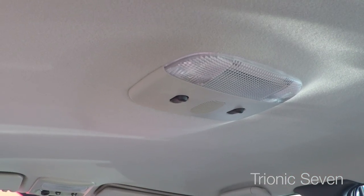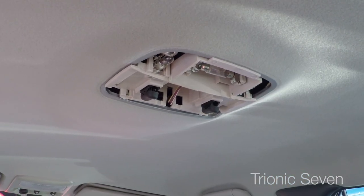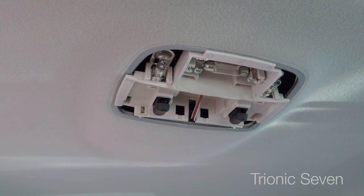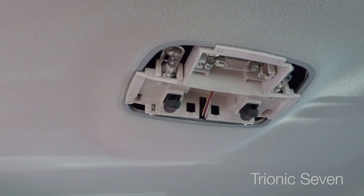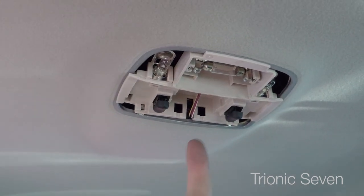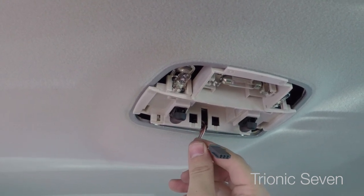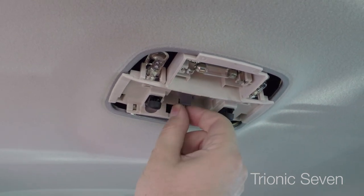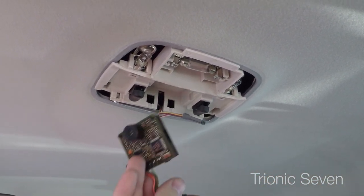So far this retrofit guide is going smoothly - we're just cruising through it. Now we remove the light cluster in the rear seat area. As I was doing the research for this video I was looking for all the wiring harnesses and connectors for the sensors and just couldn't find it in the rear. I even removed the whole cluster and felt around in the roof. Had I been looking from below or from the front I would have seen it right away - it's this little cable. This is where you connect the sensor. So it's that easy - I connect the glass crush sensor to the wiring harness and then put the sensor in and put everything back together.